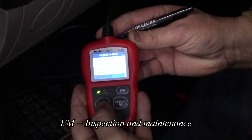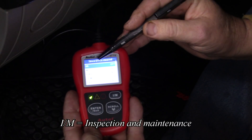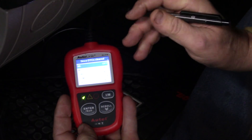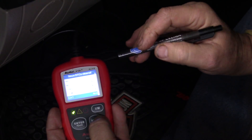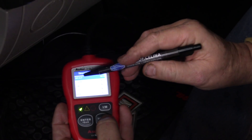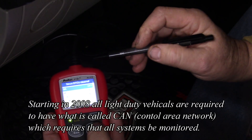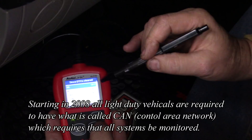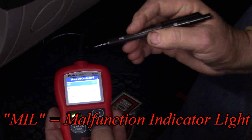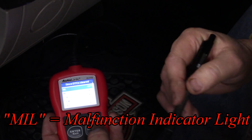In the IM Readiness — hit enter — my check engine light is off. A lot of things I've noticed on this car are N/A, and that is not a limitation of the tool but a limitation of this old car. What that's saying is that these monitors or components are not being monitored because a 2005 Dodge didn't require it at the time. I'll put down below what MIL stands for — I can't remember but I'll note it. I'm also not sure what CCM means, but I'll put that down below if I can find out.